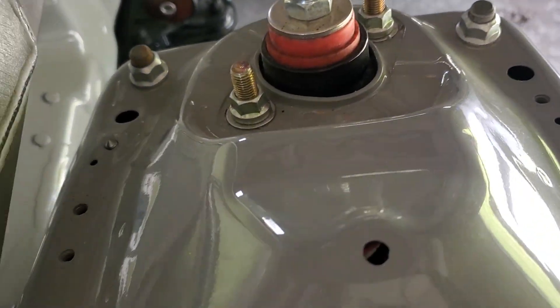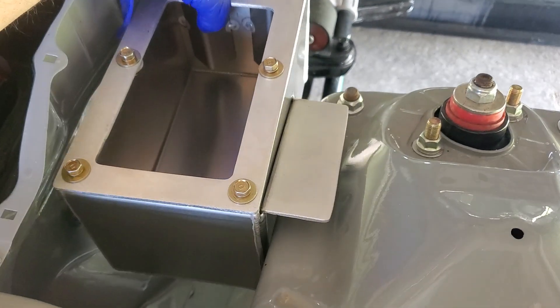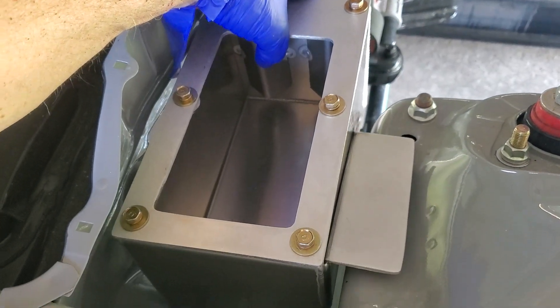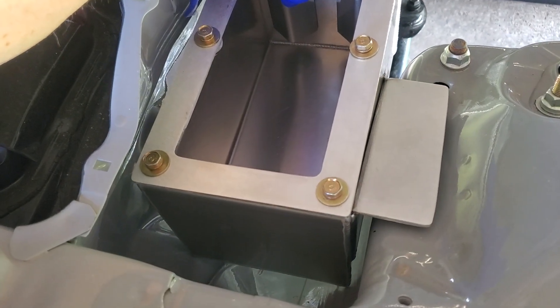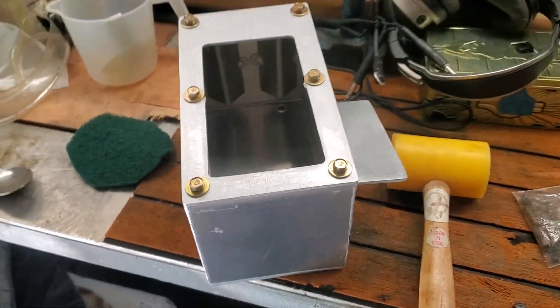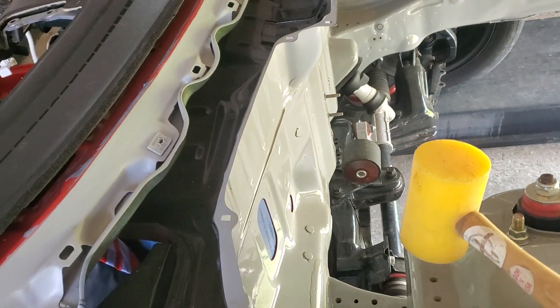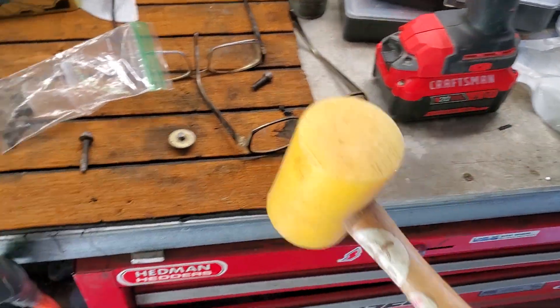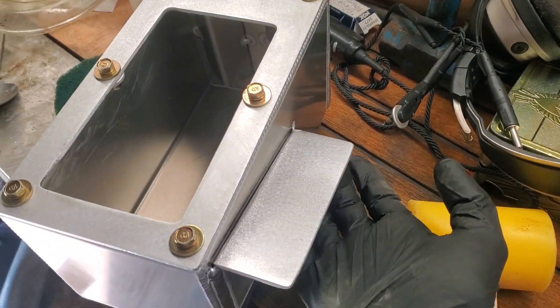You see the little piece I put in there. I'm going to set the catch can in there and line this box up right where I need it — right above that sharp pin that I screwed into that 10mm hole. I'm going to get it right where I want it and hold it very, very still. After I get it in there, I'm going to take a soft hammer and whack that aluminum lip right there — not even that hard, very light. Just very light. You're just looking to make a small prick on the other side.